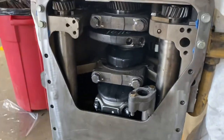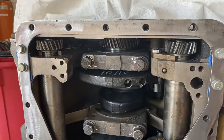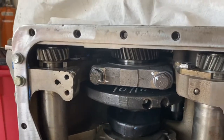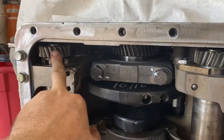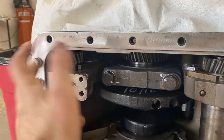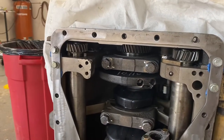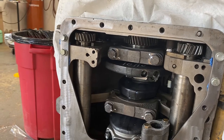Once they're locked in place, you're ready to install your oil pump, and your oil pump is what keeps your balance shafts in time. You've got the idler gear on the oil pump — it drives off the crankshaft gear and turns what we'll call the left side balance shaft gear. Then the actual oil pump gear rides on the right side balance shaft. That's how you time it, and if you have these out of time they will shake and vibrate.